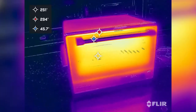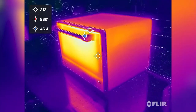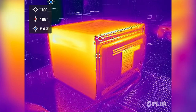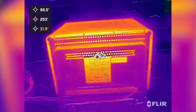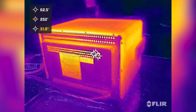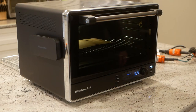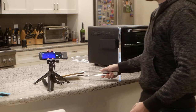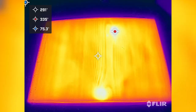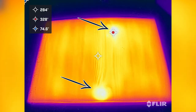The next thing we're going to look at is how evenly it cooks — nobody likes a product that gets one side hot while the other remains relatively cool. To test this out, I'm going to break out my thermal camera. It's extremely sensitive, able to see differences as small as 0.06 degrees Celsius, and also gives us a good idea of where the oven vents heat as it operates. We'll cook a piece of cedar, used for planking salmon, for 10 minutes, and then take a look with the infrared camera. The result is a really nice performance — I'm not seeing any differences to speak of side to side. The two bright spots are actually dark knots in the wood, so it's expected they'd absorb a little more heat.